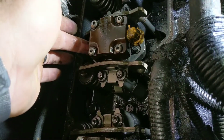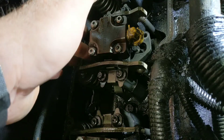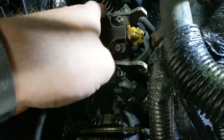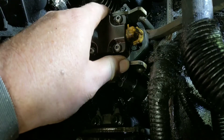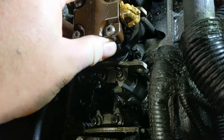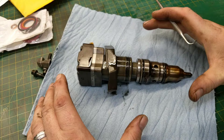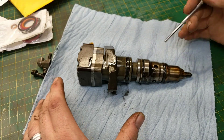After you remove the 8mm bolt down here, the plate just slips forward and up around the top screw. I like to take a little pry bar down in here and give it a good tug — it'll pop the injector right out. You can see it's already moving, and then the injector you can just pull straight out. Here's an injector on my workbench — I want to show you how these things are designed so you know what's going on under the hood.